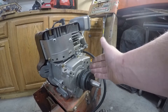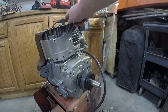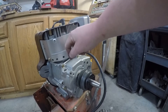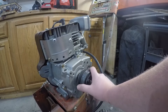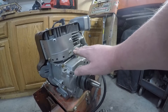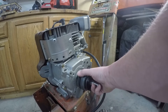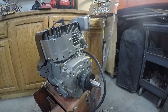If you're doing something similar — putting a pulley on a smooth shaft small engine — here's a quick tip on how you can hold your crankshaft still. Remove the spark plug, get the piston about halfway up, and then put a soft nylon rope down inside the spark plug hole, filling the cylinder full of that rope. Then grab your crankshaft and turn it the direction you're going to be turning your wrench until it stops. What happens is the piston comes up, contacts that rope, and can't make it to the top of its travel. That will allow you to torque your bolts. Then you can just turn the motor backwards a little bit, easily pull the rope out, put the spark plug back in, and you're ready to go.